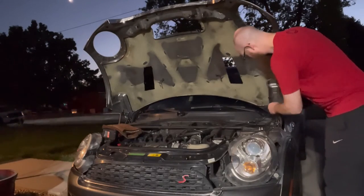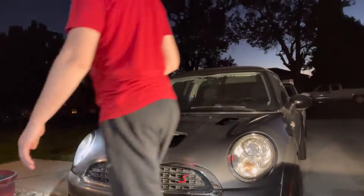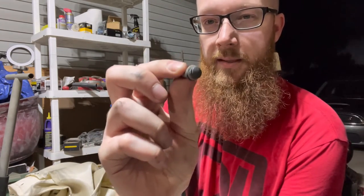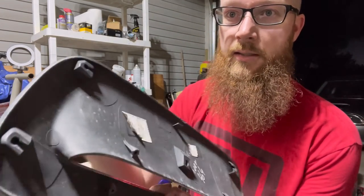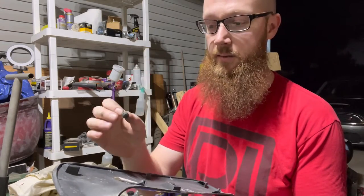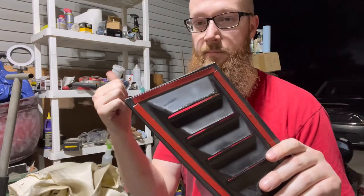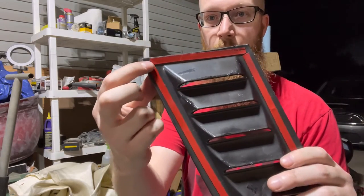Right here is where I added those washers for the shims to make sure the height was good. I tightened it all back down and grabbed my flashlight to make sure all the fitment is good on our panel gaps. As for the scoop, I told you guys it's just attached with little plastic trim panel retainers — some people just call them plastic poppers. We've got five of them that slot into these slots, and that's what retains it. As far as both of the vents go, I've got some double-sided tape — I'm not sure what brand it is, possibly not 3M — and I'll be peeling off the red backing and sticking these down.